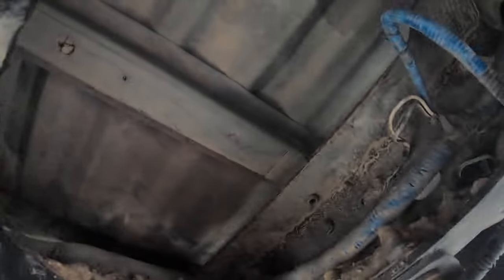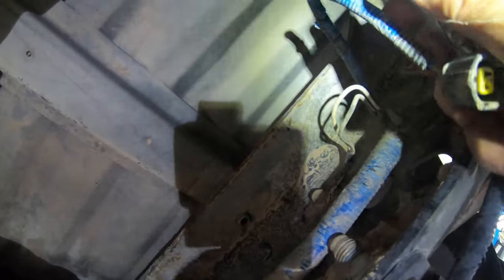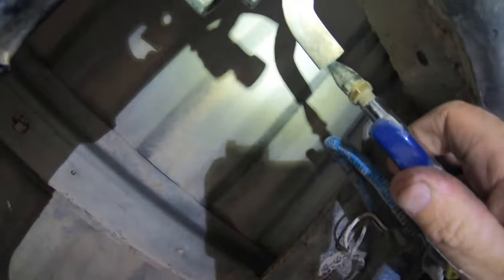I've got some compressed air — only at about 30 psi, it wasn't very powerful — and I'm going to put that in the end of the tube and blow it out. The first time I did it all sorts of dirt came out, but just for demonstration you can see I'm blowing air through it here and it will come out the other end where the connection fits into the frame rail. It's just a poor design and it's really susceptible to having mud get caught in it.